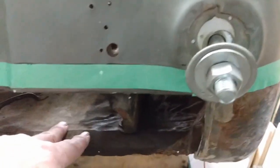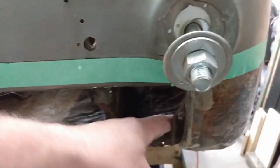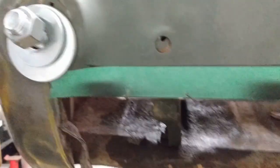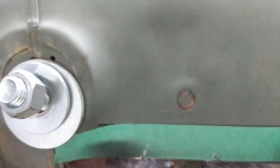I was initially just considering taking it out to where it's rusty, but I've discovered along the line here that the car was hit at one point on this corner. So if I pull this out and get these brackets out of the way, it will give me a chance to do a proper repair down in this corner. I'm going to pull these brackets out — I've had some penetrant on the bolts holding them in. You can see this hole in the bracket that they pushed down on the floor; those should line up because that's where the bumper bolts in, but you can see it doesn't quite do so.